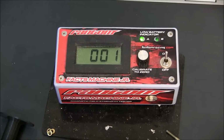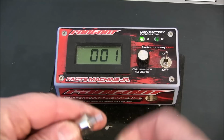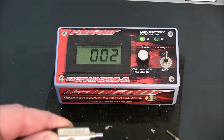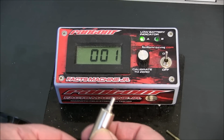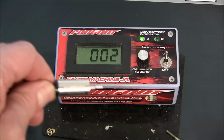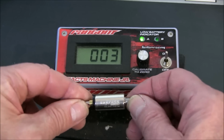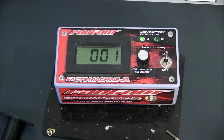Tested the rotor strength. Both these rotors have got the same code on them, and they've got the same size actually engraved. Surpass, it's got the size engraved on it: 12.5, 7.15, 25.2. The 25.2 being the length of the magnetic part, which is a reasonable length. I measured it as well. The longest one I've found, I think, was a Motive, which was 26.0 millimeters, and normally 24 is short. So 25.2 is one of the longer ones, which we know gives better performance as well.